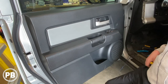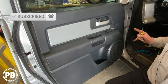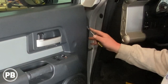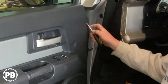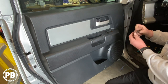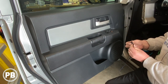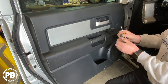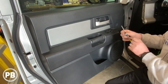To get started, the first thing we need to do is get this door panel off so we can replace that mid-range. There are two screws as well as a little clip here on the side. For the clip you just press the center in, it pops in just barely, and then the whole clip comes right out. You pop it in and then it comes out as a whole piece, and when you're ready to pop it back in you just pop the pin back out in the opposite direction, reinsert the clip, and press it flush.